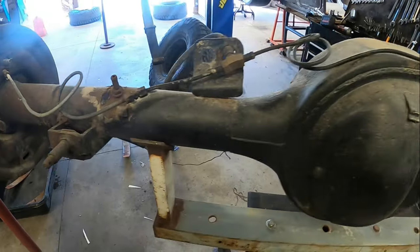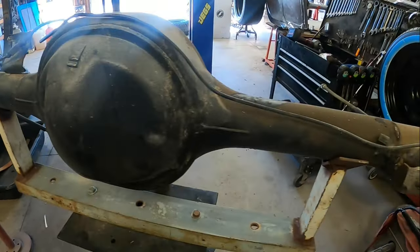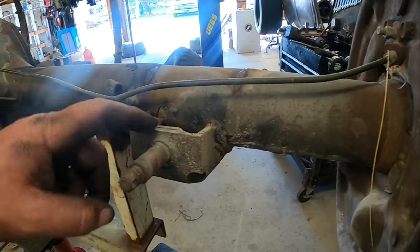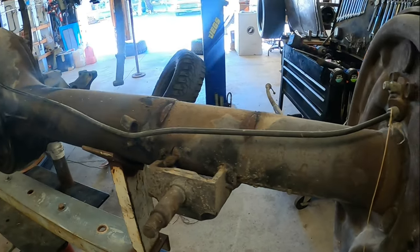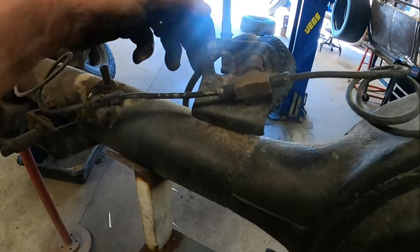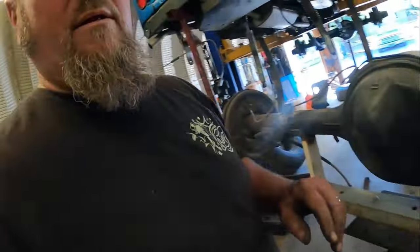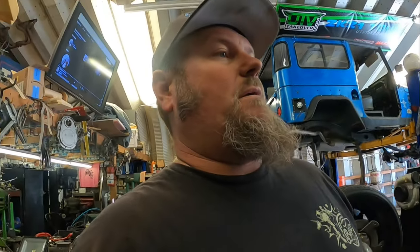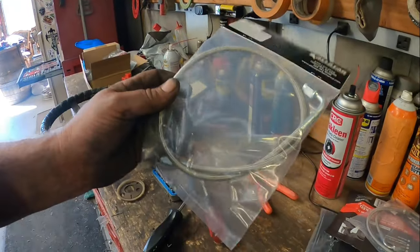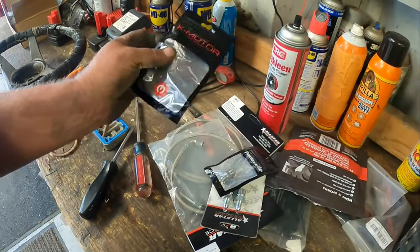All righty, so I'm gonna go ahead and redo all the brake lines. Look at this - it's got a compression fitting in between. That's nice and safe. I'm gonna get all these things cut off and redo them. I don't know why the studs are here. Get the whole rear end cleaned up and whatnot, new brake lines all the way across. When we ordered parts, we ordered all brand new stainless steel lines and all the new fittings to make all the brakes back to flawless.